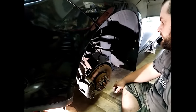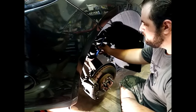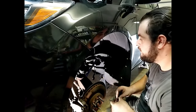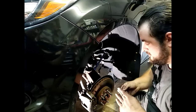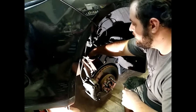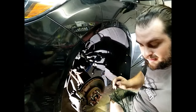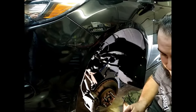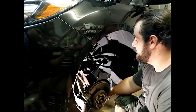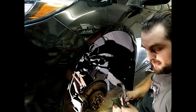And every time you lower a vehicle, you change the suspension geometry of the vehicle. Like independent rear suspension cars like Anthony's, you'll have more negative camber in the rear as well. Unlike the Mustangs, any of the 2014 and older ones are a solid rear axle, so it doesn't change. But we should have some negative camber on the front as well. The factory needs work, the way the Focus comes from Ford, it sits and wears tires out a lot faster. So you should ideally get the rear adjustable suspension component.